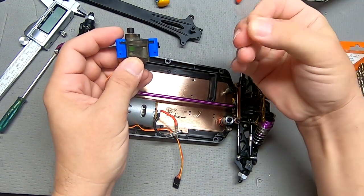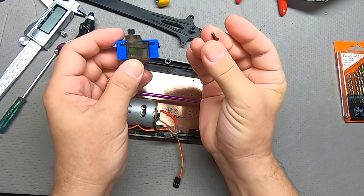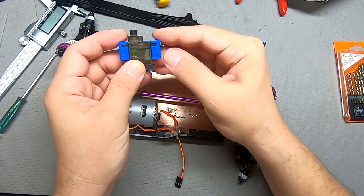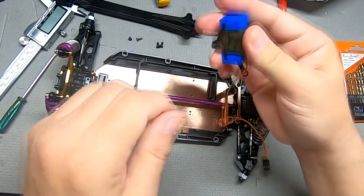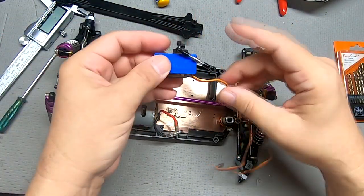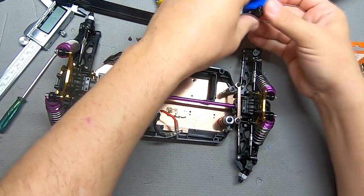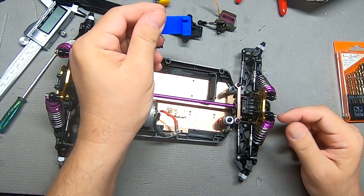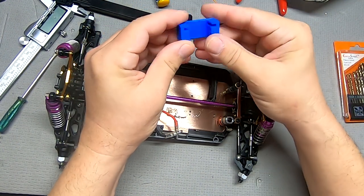And I'm going to be using some Allen head regular type of screws. I just need to widen these holes out a little bit, and then I'll pre-tap them so I can have this held in my hand, using an electric drill and one of the screws, before I go ahead and bolt it on. That just makes it easier to work with. So I'll make the CAD plans for these available, and I'll make the Cura file available as well for those of you who don't want to deal with having to figure out the slicing yourself.